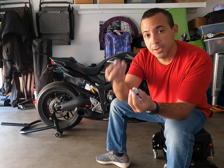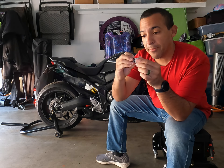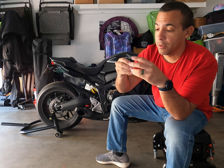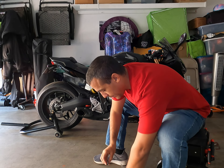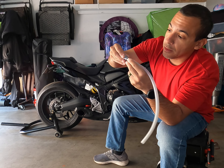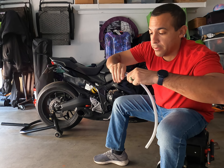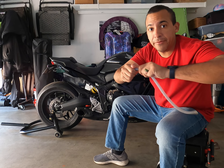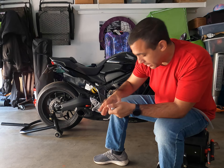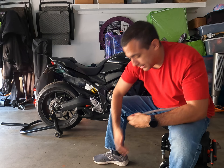Instead of using the bolt to take out the oil, let it drain, then reconnect it and do your torques over and over again — no need for that. This bolt right here along with this cap will hold the oil in place. It's a one-way opening — there's a ball bearing in there. This is the tool used to drain it; there's a drain hose. Push the ball bearing, twist, and now you can drain. Once done draining, push, twist off, and recap it. Done deal.